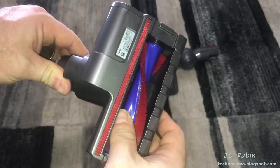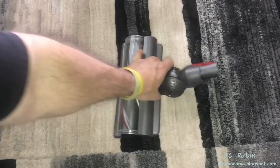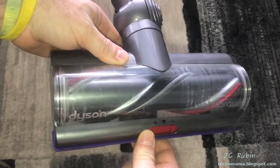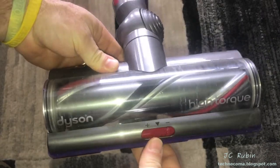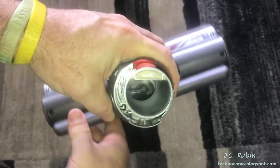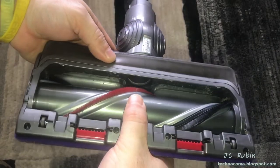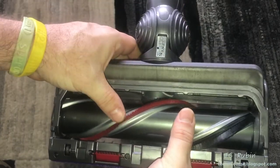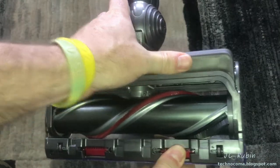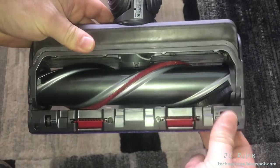Check to make sure there's no binding on the brush - everything looks brand new, perfectly clean, ready for service. The torque drive head will be a similar procedure. I'll inspect it visually - there's a switch up front for suction mode, make sure that's moving freely. Turning it over, I'll make sure the electrical connector is unobstructed. Looking inside, make sure there are no obstructions through the tube - the roller itself is visible, make sure it moves freely and isn't bound. There's a rubber mat in the back - make sure that's not broken or damaged, and the little wheels up front are also moving freely.